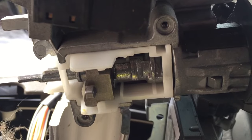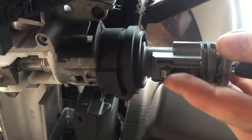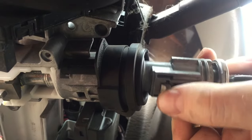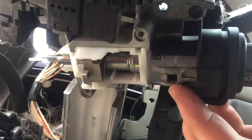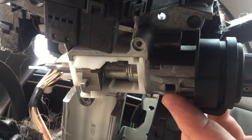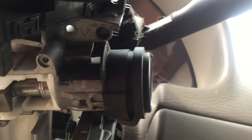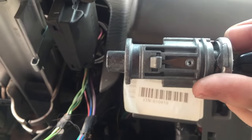I'll go ahead and get this one out and show you the new one. I've got the ignition switch out of the way. There's this little push-in keeper right here — I can push it in with my finger or a screwdriver. It sits in this little hole. So you need to push on that same little tab right there with a screwdriver, then you'll be able to pull the ignition cylinder out. There's my ignition cylinder sitting out; there's that tab I was talking about right in the middle there.